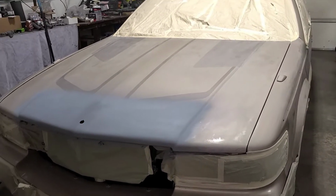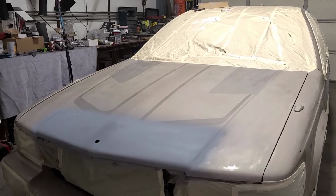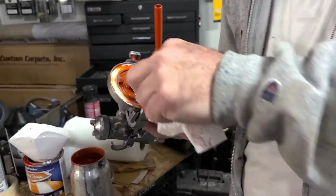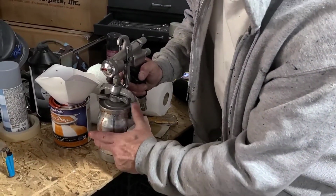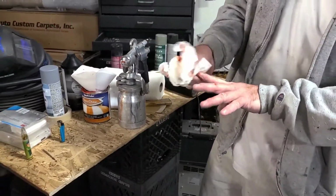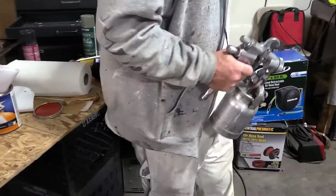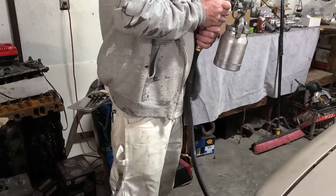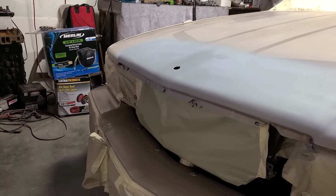See, it's relatively not that big of an issue, but there was still some old funk in here from the last paint job, which was about 6 months ago. Not good. It's very important to clean that. Oh yeah, clean it up a little better than that. And you should probably check them over too. Most people use gravity feed, so this problem isn't an issue. But if you're using a metallic paint, that's going to be a big issue. Since it's just a pastel with no metallic in it, it's not an issue. On? Yep, perfect.